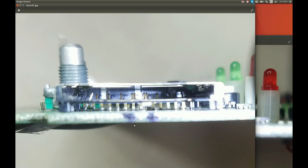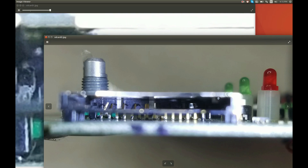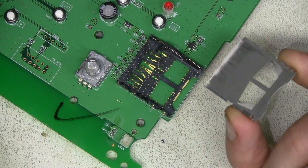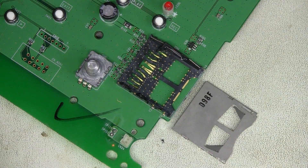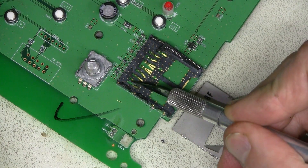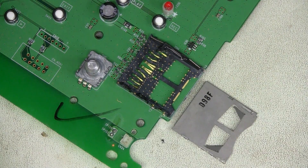Here I have a couple of pictures. We can see all the pins in the slot and this one on the left must be bent. It turns out it's quite easy to remove the little cover, and there are a couple of springs in the ejection mechanism, so you need to be careful not to lose them. And we have a problem — I just started bending this little pin slightly and it broke right off. Here is the broken-off piece. So I think I need to replace this SD card connector.